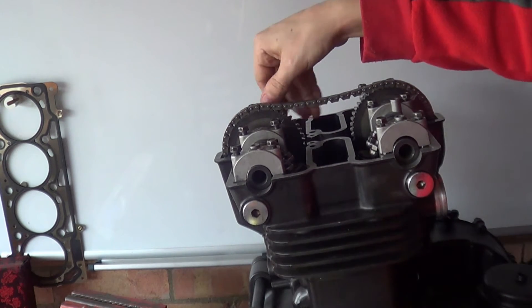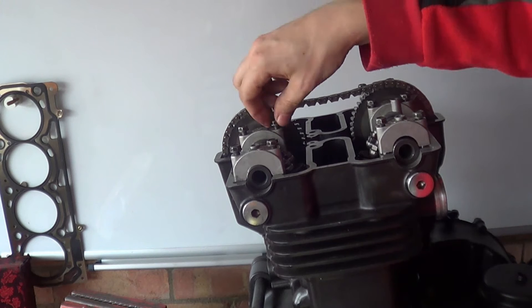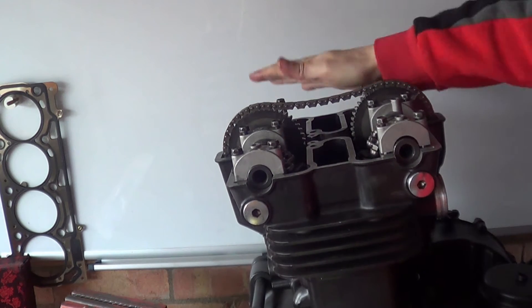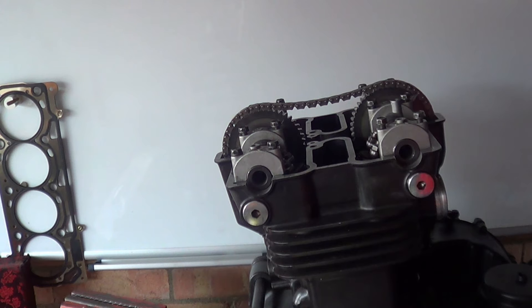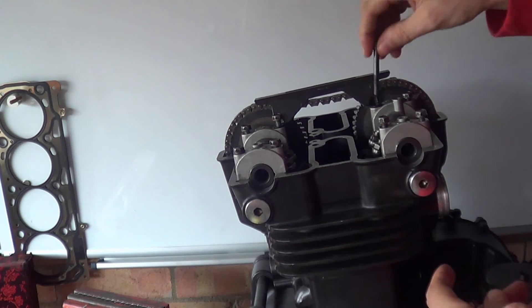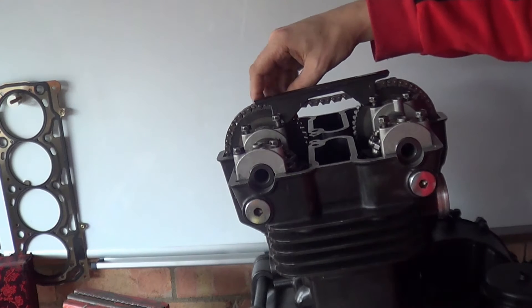If it just doesn't smell right, think about all these things rotating and it becomes pretty obvious - like that example where it was going to hit the bolts on the sprocket coming around. This is why I do a dry run, but even before that just keep your eyes and ears open. Right, now we're going to torque all these bolts down. I think these can't be torqued down yet because that holds the brace - the chain guard - so I'll put that on as well. There's an arrow on top of that which needs to point forward, like every other arrow on the cam caps.